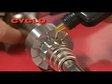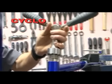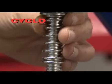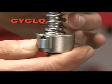Apply the cutters with cutting fluid before inserting the tool through the head tube. Secure the tool with the centering cone, thrust bearing, spring, and quick release nut. Turn the quick release nut to apply a light preload to the spring.